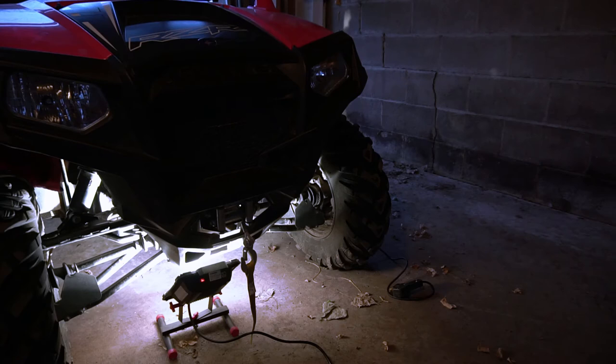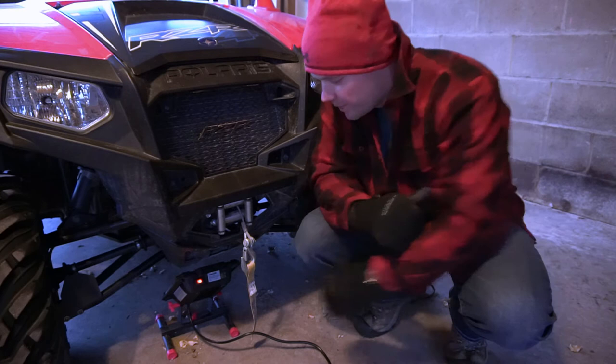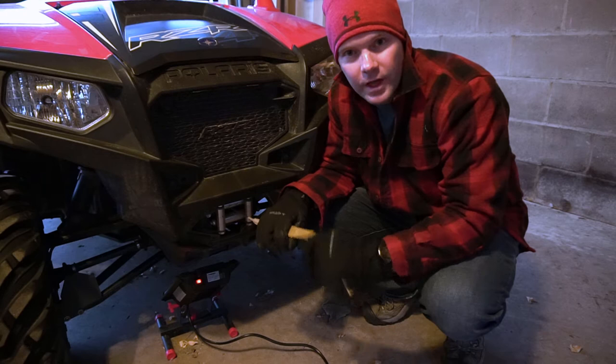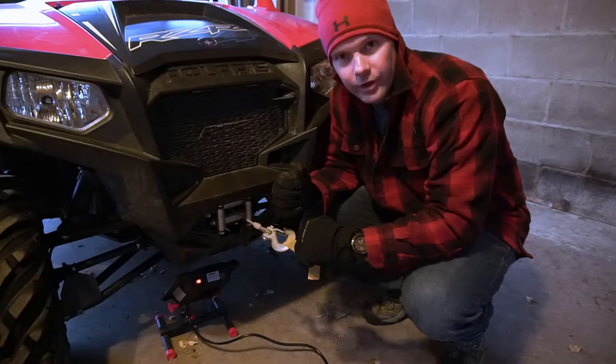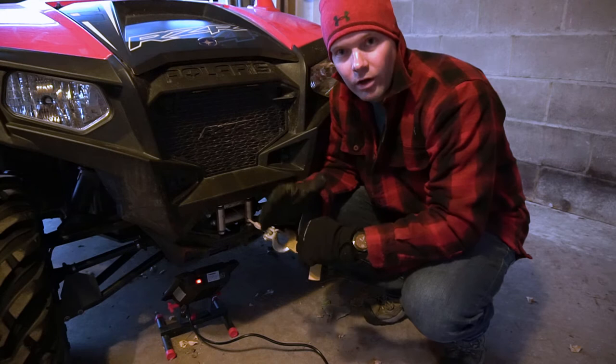So visual inspection's done. The only thing I've actually visually inspected at this point is the cable. That's tip number two: winch cable operation and inspection. Now we actually want to do a visual inspection and operations check on the winch cable and the winch itself. What we're going to do first is free spool this all the way out, then bring it back in with the motor, then power it all the way out and bring it back in again. During that time, we're going to check the cable itself as well as talk about tip number three.